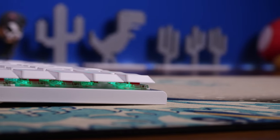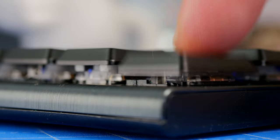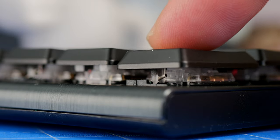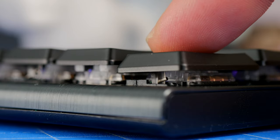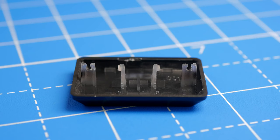Now you can see some of the experience, and I'll talk about the switches in a bit more detail here. Obviously these have different switches in them. The G915 TKL does not have hot swappable switches, so you can't take the switches out and replace them. They are available in various variants, and I'll leave all the specs in the description, but the black and white ones have either GL tactile or GL clicky, and you'll see when you take off the keycaps that they have multiple points where they're sitting in there.